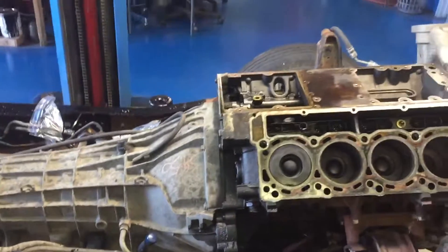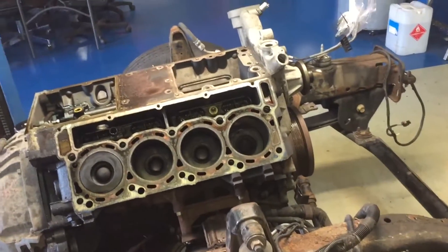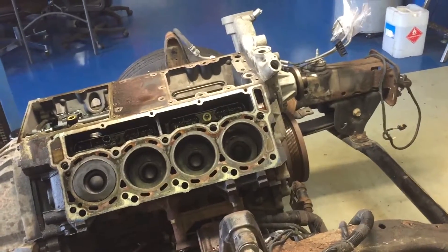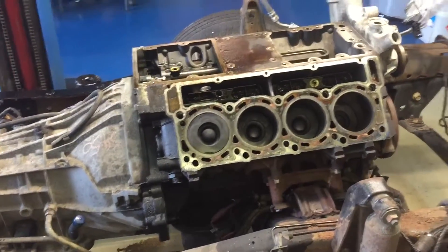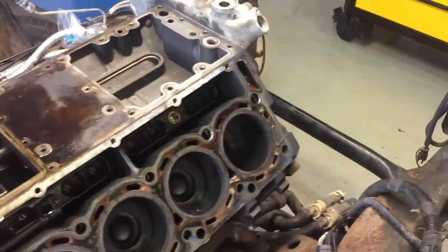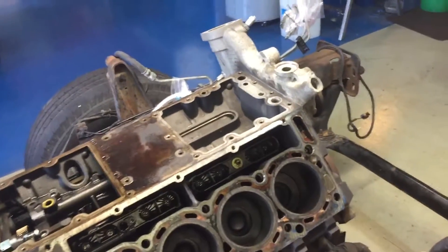I'm kind of building up to this: we're going lifters, so I'm going to have the crankshaft exposed. When we do lifters, we go ahead and do the bedplate seal. It is a pretty good leaker — it's been leaking. So we'll go lifters and total oil reseal, get everything sealed up. We're going to have the crankshaft exposed on the stand, upside down.